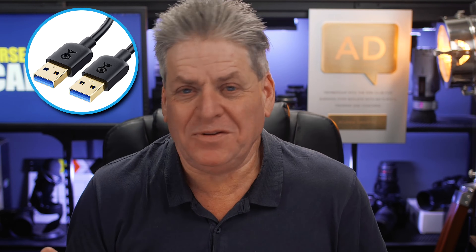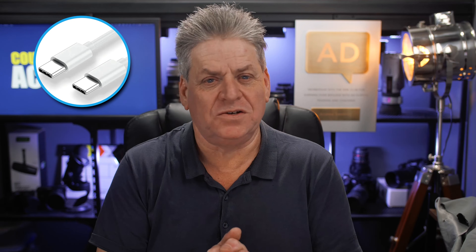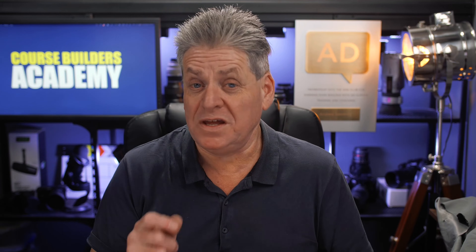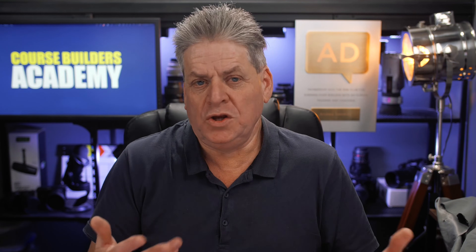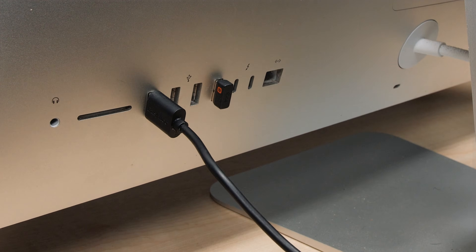To start with, let's go USB — it's really simple. Equipment-wise, all we need is a USB cable, and it's worth getting a decent quality cable. If your camera and computer support USB-C, great — those are the little oval connectors. But if not, if you're using the older style USB cable, just make sure it's USB 3, the one with the blue insert. If it's the older USB 2 with the white insert, it's going to reduce the resolution of your video and we don't want that. Once you've got your cable, all you need to do is plug the USB cable into your computer.